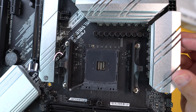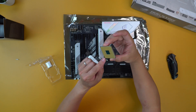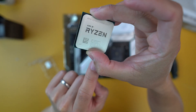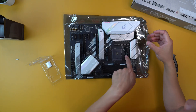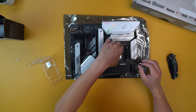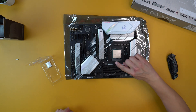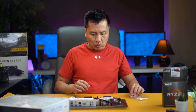There's a little arrow right on the corner right there — you're supposed to match the processor up with that arrow. Don't worry, it's not going to blow up or anything. So here's the arrow on the processor right here. That's a beautiful piece of processor right there. You're supposed to match it up with the arrow on the socket. I believe it's supposed to just drop in once you align it. There we go — boom. Let's just lock that in. There you have it. Success — processor is installed.